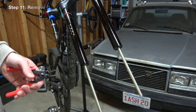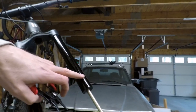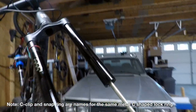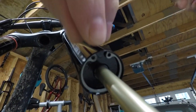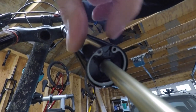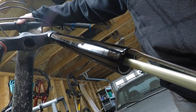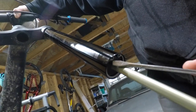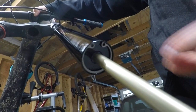So this next step, we've got the bike lifted back up. We have our compression side here and our air shaft side here. On the air shaft side, up underneath, you're going to see a C-clip or a snap ring. We have a set of snap ring pliers here. There's a snap ring and then there's a black plate, and there's a little black square that sits in between. So what you want to do is take a flat head, push on that black piece, and then twist. You start from one side — you can see there's a little bit of a gap right here, so we push and twist. Now it's under the snap ring, so you can actually compress the snap ring and pull it out of the groove.